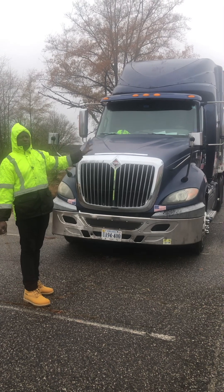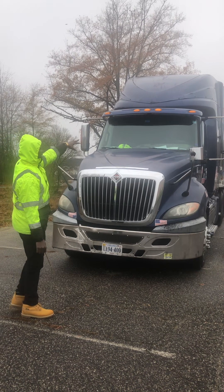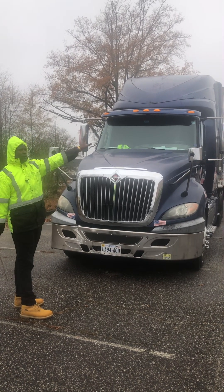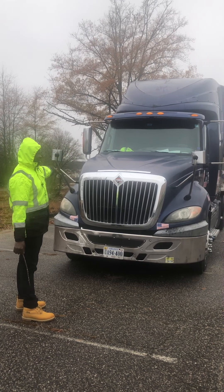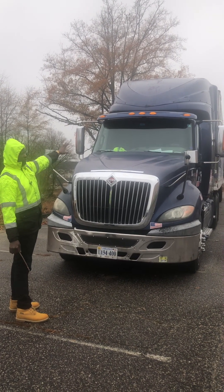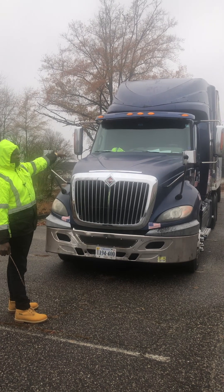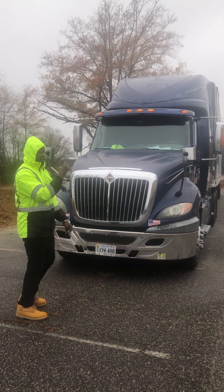Make sure all the equipment on this truck is working. I will start from the top - check my three ID lights and my two marker lights, or you can just call them clearance lights. All of them - we see marker light and call them that. They are amber in color, mounted and secured to the vehicle, not bent, broken, or cracked. I detect no moisture or condensation.